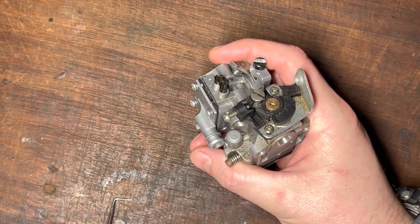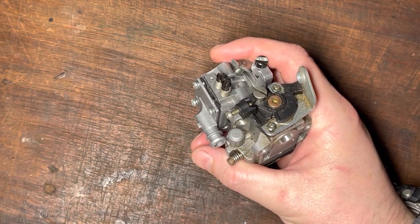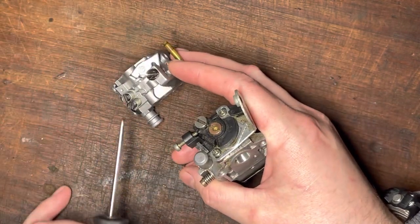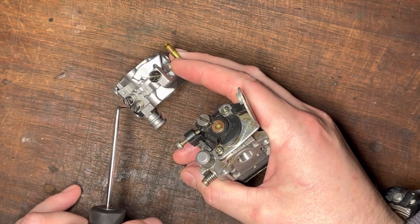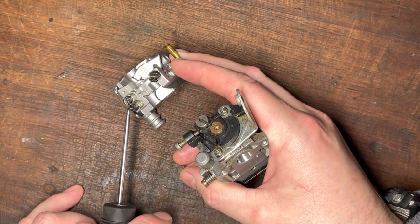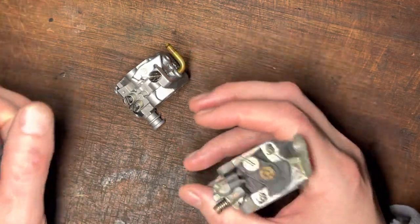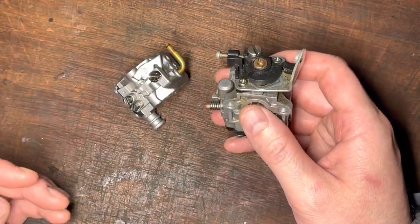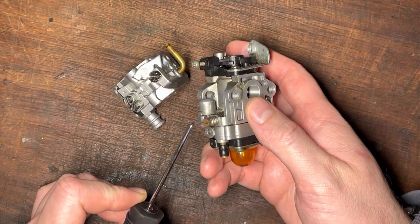When they've come back down, that is a symptom of too much fuel on the high-speed side — not the low side. Even though they work together, it's a high-speed fuel symptom. If the engine idles fine and everything's great but when you come back off wide-open throttle the RPM drops a lot and it wants to die, you must lean out your high-speed screw.